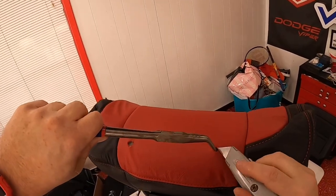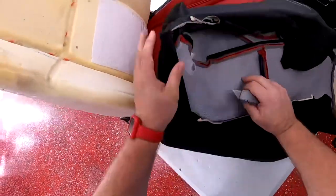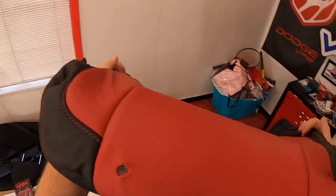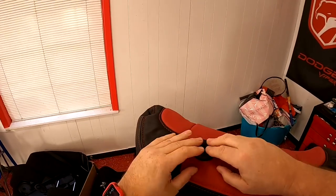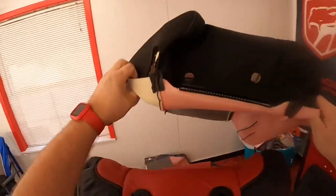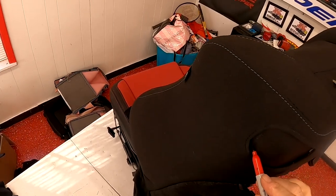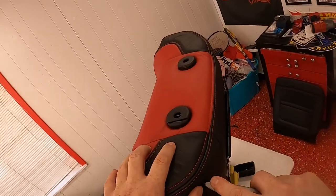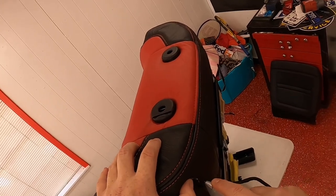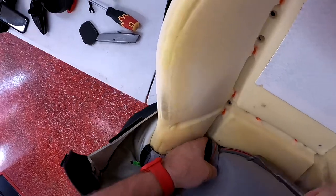Make the holes a little bit bigger to fit what you need. The outside leather part is easy to cut; the inside part you'll want to trim just a little bit so it'll go back on. Take the posts back out from underneath — they'll have to fit through the leather. Once you've got the holes cut where you want them, lay the seat back on and put the posts back in, and everything will be fine. It is scary but you can get through it. Then as a guide, I put the old cover back on to cut a much bigger hole for the pull latch, drawing a hole just slightly smaller than the factory hole, then trimmed it a little bit at a time. It's always better to start smaller than bigger.